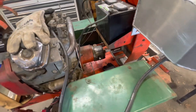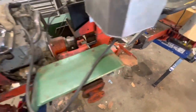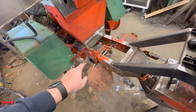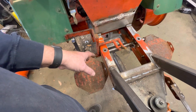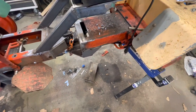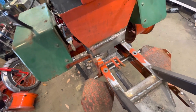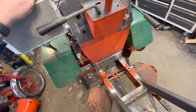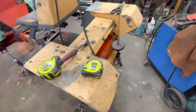I'm figuring out how the hydraulic lines are all going to run down through. I've got to do the brake pedal and I think I'm going to move things around once I get the other pedals on here, then do a link up to the front and something to actuate the rear brake as well. When you press the brake it automatically centers the control for reverse — I need to decide whether to incorporate that into the design or not. Still lots to go, but definitely getting closer.